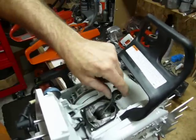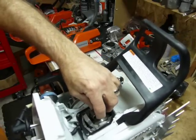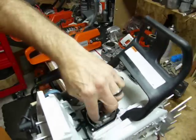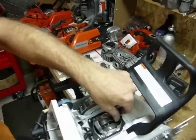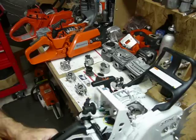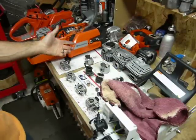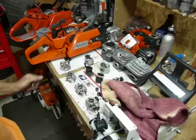Looking at the Stihl for a second — you can see the air guide there, just allowing airflow to go kind of wherever it wants, but you can see the cylinder has a pretty big fin area and surface area, which is necessary. There's a cool little piece of cast aluminum where the piston skirt goes on the back side of it in a slot, and the rod goes on the front side. As it's going down, it's trying to charge the front half of the cases by taking up volume underneath the piston — directing it out toward the front where the transfer ports are. We won't talk too much about the Stihl clutch cover; they're definitely the best on the market.